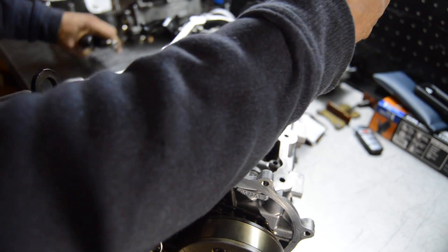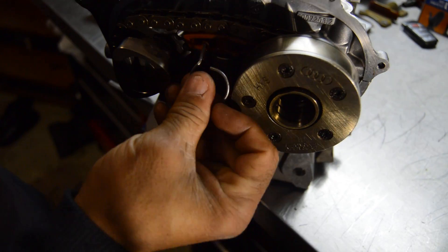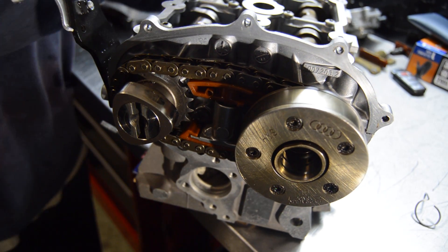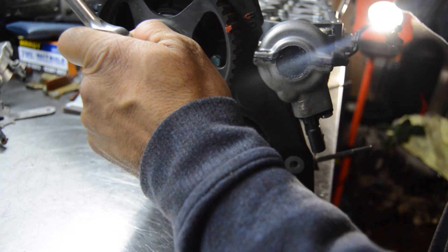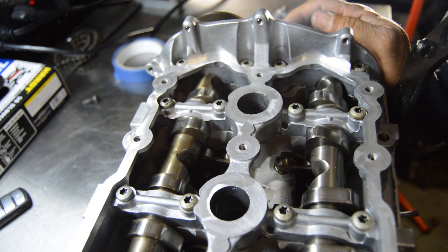Release the vice grips — this pin is already released. And then you will see, if you come back around to this side, that it is still in time, with the two cams facing each other, which indicates that the timing is set.